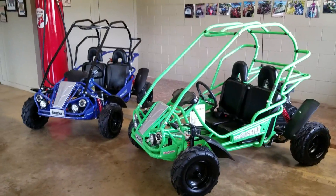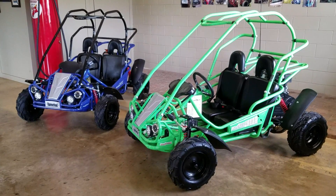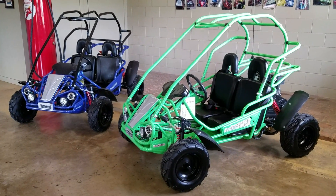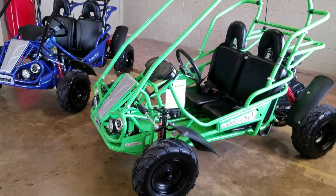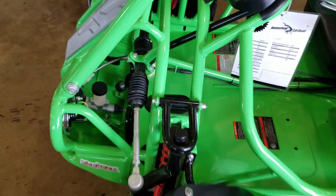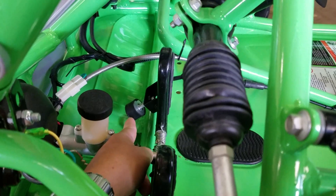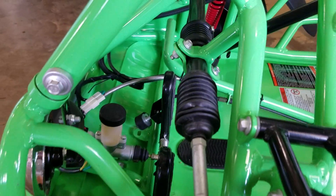Something that they have in common: they are both recommended for ages 9 to 14 years old, so these are recommended for younger kids and less experienced drivers. They both have a maximum speed of about 30 miles an hour. That can be governed back — there is a very simple throttle bolt on the backside of the gas pedal, located right there. It's a very easy mechanism in order to slow it down or speed it back up.